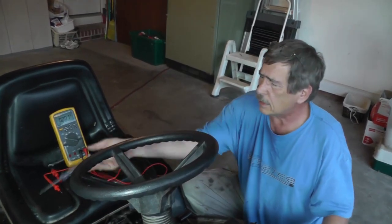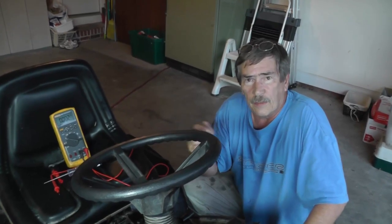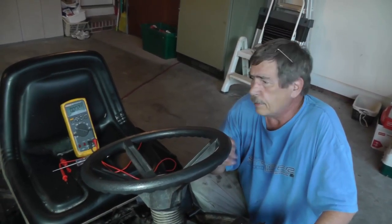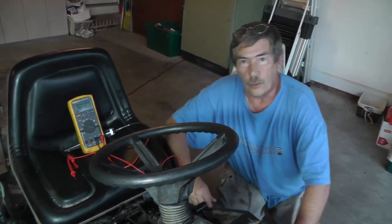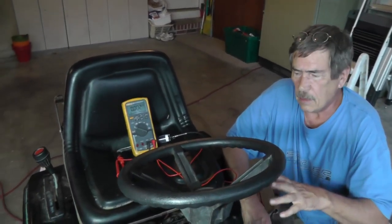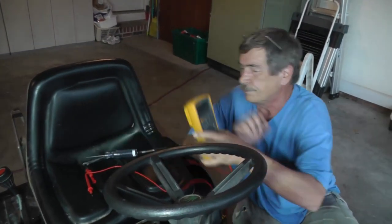But for the ones out there that want to see how much voltage is really there, let's demonstrate another tool here from Dan Sullivan. We'll give a shout out to him for his tool. It's called a Load Pro. This will actually load the circuit down, and we can actually see what kind of voltage is out here at the load when we load it.